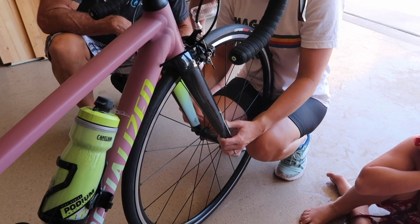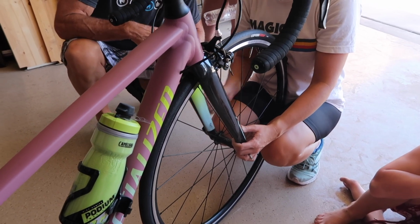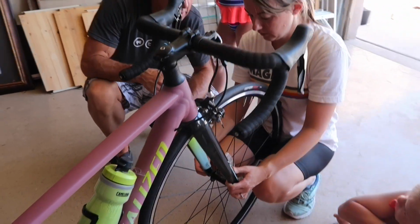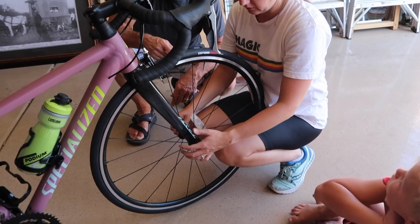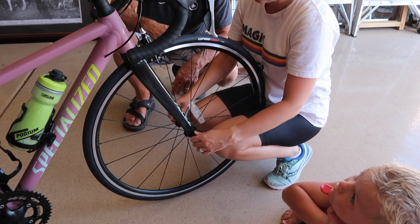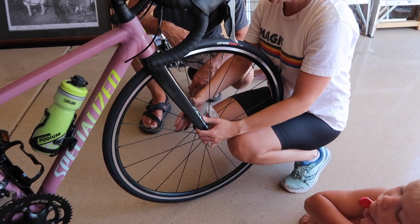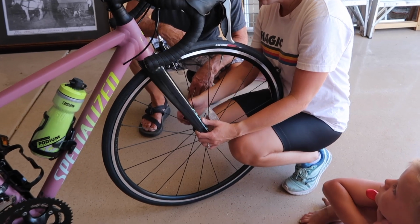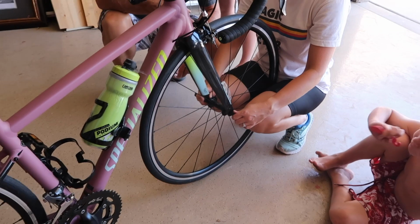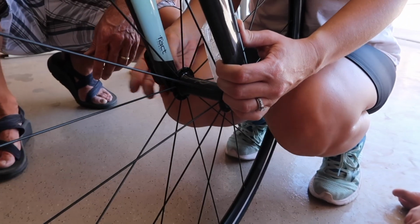So you want to loosen it again and then close it again. I only did like 4. Okay, so now it's a little too easy. So now what I would do is on your left hand, turn that thing in like a quarter of a turn, tighten it. Just that, now see how hard that is to close. Pretty easy. Maybe go a little bit more with that, a little tighter on the left, yeah, and then now tighten the skewer. There, that's a little better.